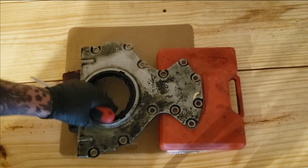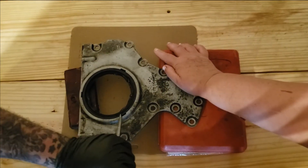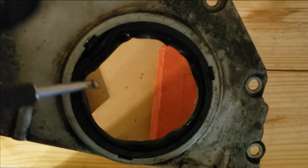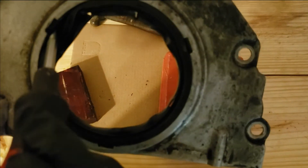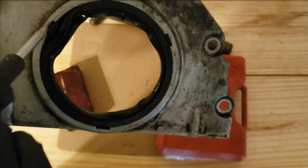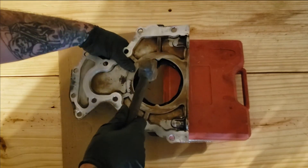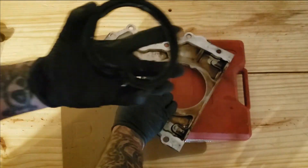Another way you can do this is get somebody to hold it or put it in a vice so it doesn't scoot, and bend this seal over by tapping the edges. When doing this, you want to make sure to hit it at an angle — not hitting it where the seal sits because that will damage it. Keep hitting it, it bends, and you can see we finally broke loose. Tap it on the back now and it should pop out just like so.